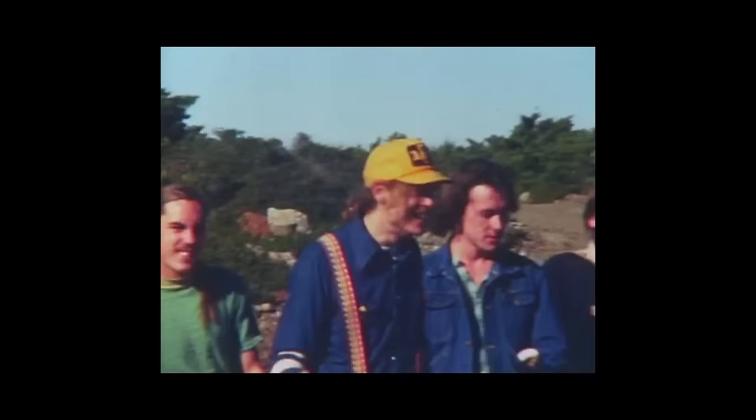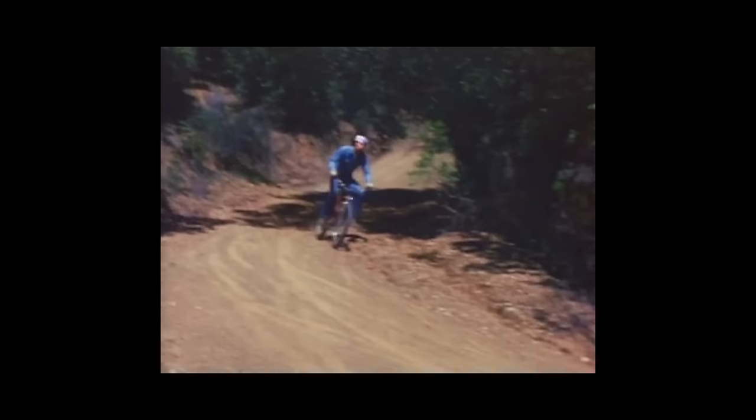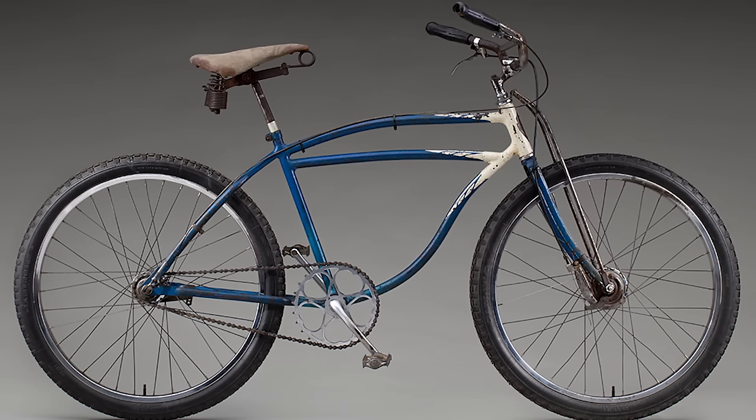I kind of like the idea of adding a little of the new to the old. This is a sketch of my 1941 Schwinn-built BF Goodrich, and it was my first fat tire bike that I ever owned. I chose this geometry from the Schwinn — the Excelsior geometry. I figured this is a great handling bike. I just wrote down all the measurements, the angles, and all the lengths that were important to design a frame, and then I drew up a frame using that handling geometry, and of course substituted the curved steel tubes for straight chromoly airframe tubing.